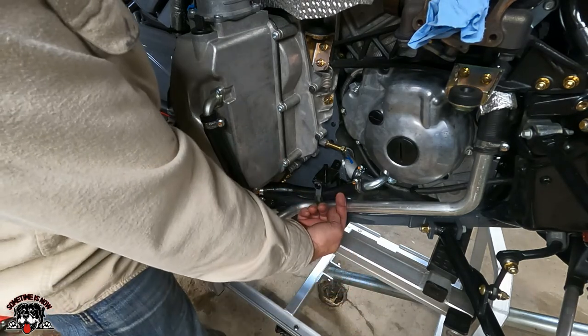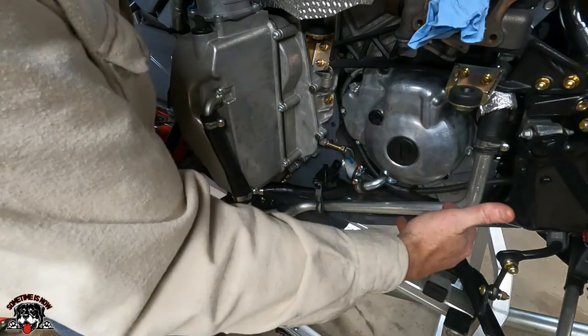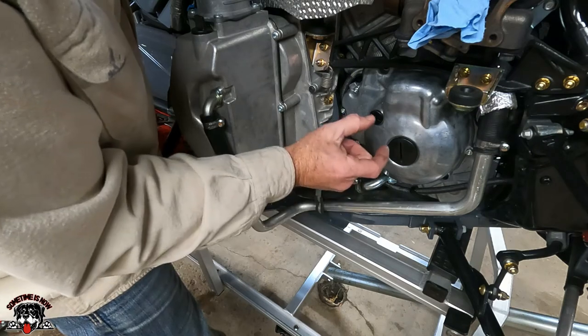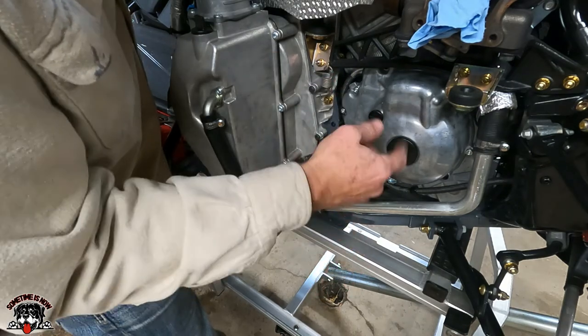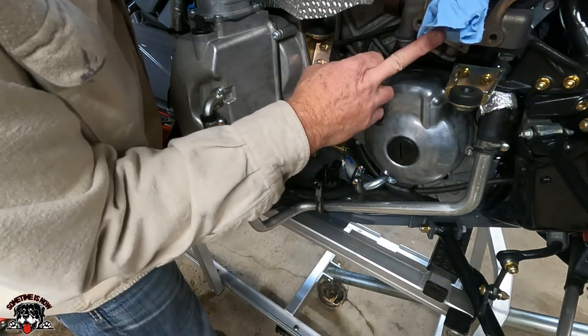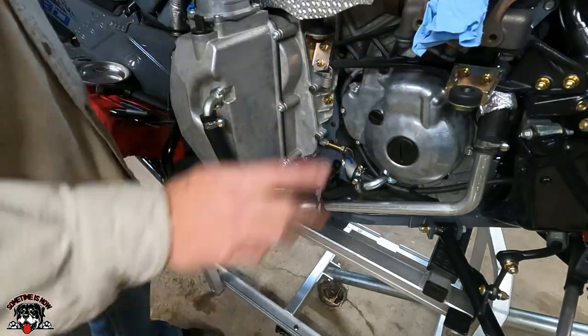So now we've got to go under, in our next video. We'll go underneath, take the cover off. We'll change the oil filter, pull the little drain plug on the bottom of the engine, get that oil drained, and then we'll fill this back up. And then we'll start going on to getting everything else installed. So stay tuned.